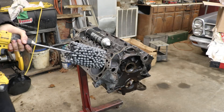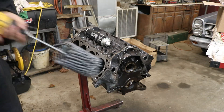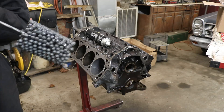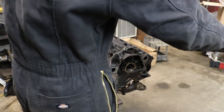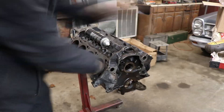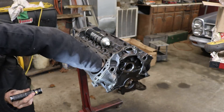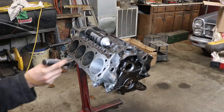When you're finished, don't stop the hone inside the bore and then pull it out, because all the lines will pull out. You want to pull it out while it's still running at full speed. After wiping it out again, it looks pretty good — I might hit it one more time but everything looks pretty good on that cylinder.